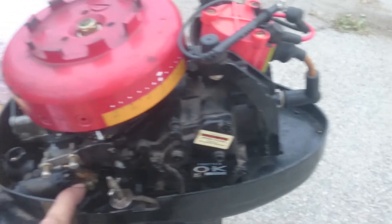She starts and runs on the first pull. On my six-foot dinghy with my wife, we get about five miles an hour with a two-blade prop. I'm not even sure what the pitch is on this — the one I broke said 6P on it. This one doesn't seem to have any markings, but there it is: 6P81. Same prop, so this is a six pitch.